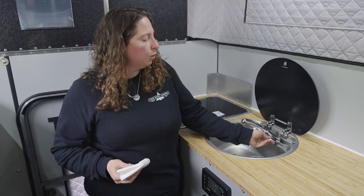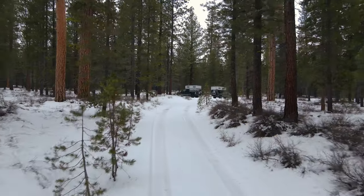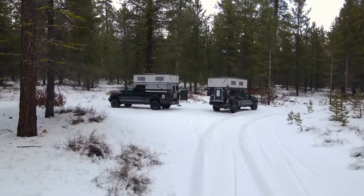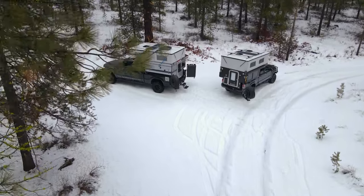The last thing for storing your camper in winterization mode is to leave your faucet open. This allows for expansion and contraction of any residual water — if it does freeze, it gives it space to move so none of your pipes will burst. Moisture can be an issue, especially in wet climates. Here are a couple of winter storage tips: one, it doesn't hurt to remove your mattress and store it inside; two, if possible, leave your camper roof popped up to allow for more air circulation.